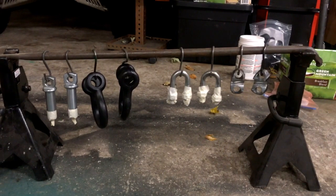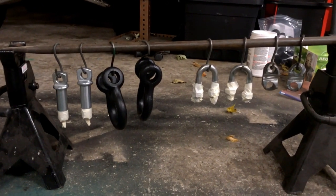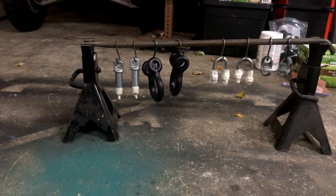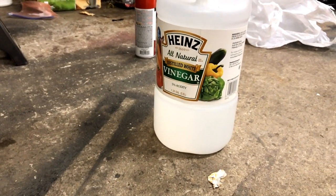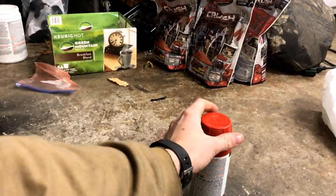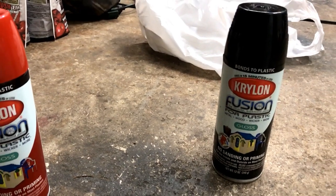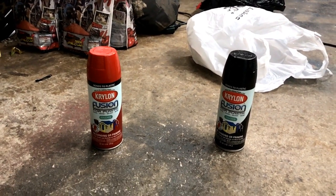A little explanation on what's going on. I got these parts painted up for the shackles on the front for tow hooks and I got them taped up. I got jack stands and a little pry bar with S-hooks and I got my parts hanging here. I cleaned them with vinegar — they were galvanized — and I sanded them down first and then cleaned them with vinegar. I'm gonna paint them. The shackles are gonna be this Krylon red and then I got this Krylon black. I haven't done much painting with Krylon — I just want to give it a shot. I've done some reading on it, good paint.